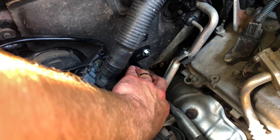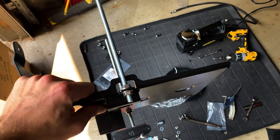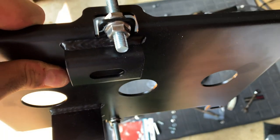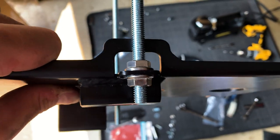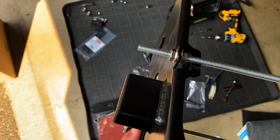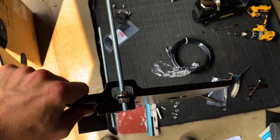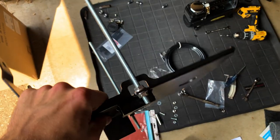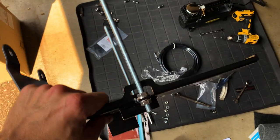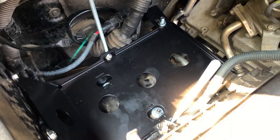I removed a black plastic clip that was on that nut and then put on this bracket — it's just loose laying here. We'll tighten everything up once we get the tray in. Let's put those long bolts on the tray. I've attached these two bolts — they go on the outside of those tabs, with no washers in between, just these locking nuts, one on top and one on bottom. I put them as far down as possible to be flush with the two spacer pieces on the bottom of the tray. I don't really want to cut these, so I'll leave them uncut like Oxfoot did.